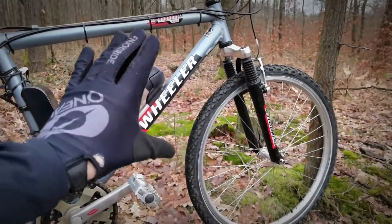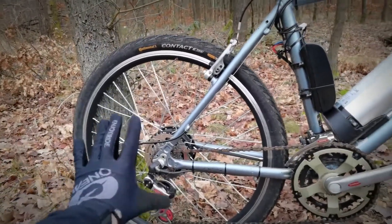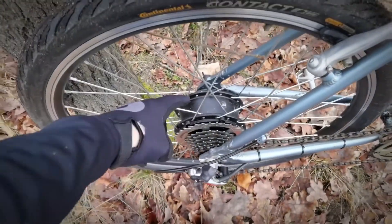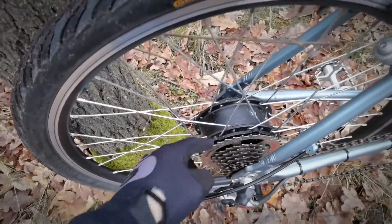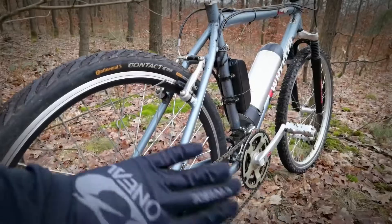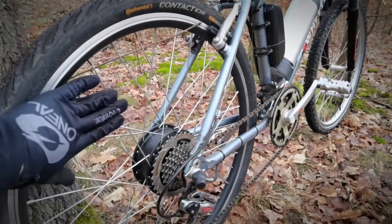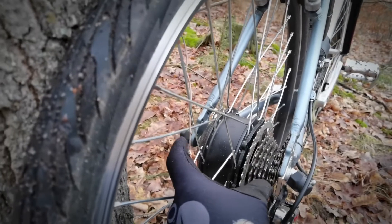Another thing: of course, if you have the original bike on 26-inch wheels, you wanna buy a 26-inch wheel with a motor. This is the rear motor conversion kit, that means we are replacing the rear wheel with the wheel from the kit — it's got the motor in the hub. You also wanna know the spacing between the dropouts, from here to there, because you wanna know the length of the axle. But these old bikes didn't have many standards for axles and dimensions, so it will be pretty easy for you to find the right wheel for such a bicycle.